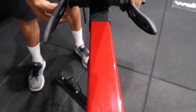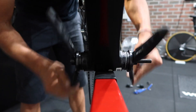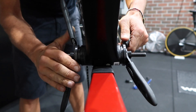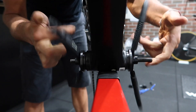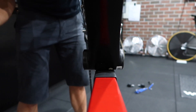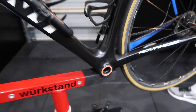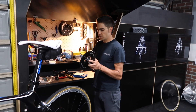Both cups are in on either side, both bearings are in. They go in easy — actually that's not what I like to hear, that means creaking. Not real flash tolerances. Might need some extraction and Loctite, but we'll see how we go — just grease and a bit of Loctite. So this now allows a 30mm spindle on the Giant TCR, as opposed to the previous 24mm spindle.